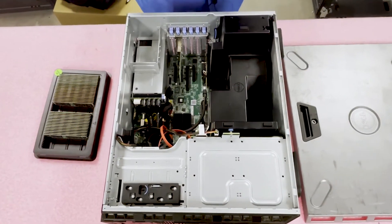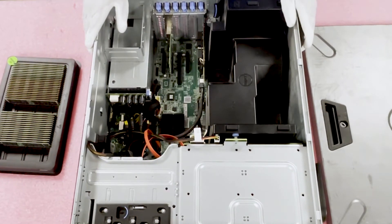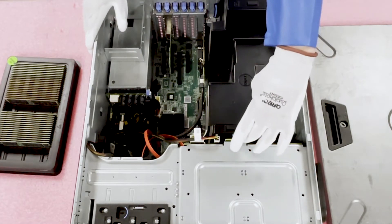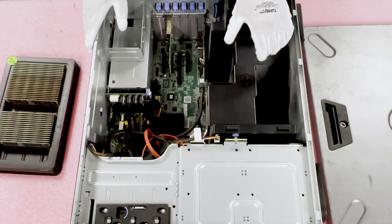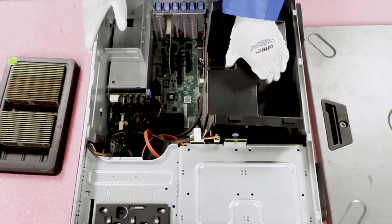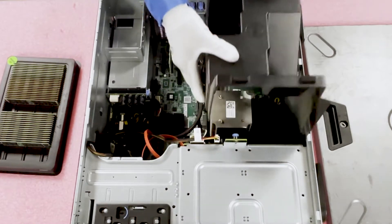When you open it up, you'll notice there is an air baffle, also known as an air shroud. This is there to regulate airflow and make sure the processor and modules do not overheat. To remove it, pull it straight up. Note that on the backplane there are some ICs sticking pretty far out, so you don't want to lift and pull back — you could potentially damage the board. Pull it straight up, go slow, it's kind of snug.